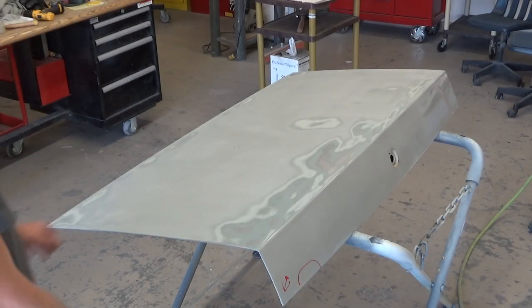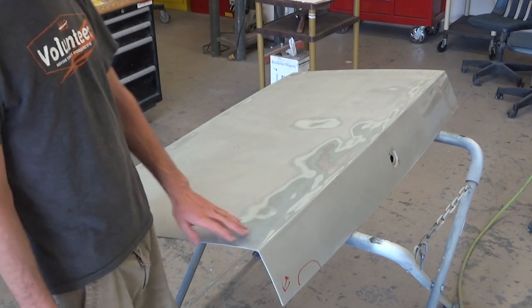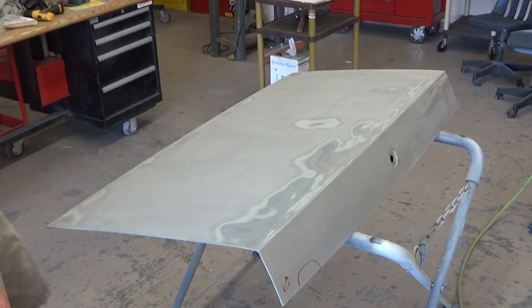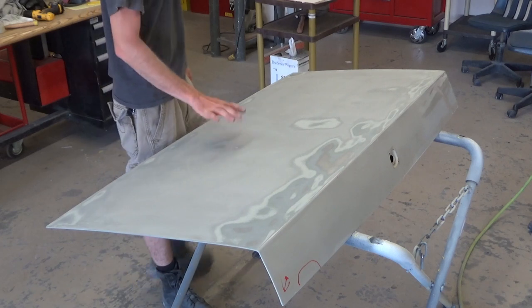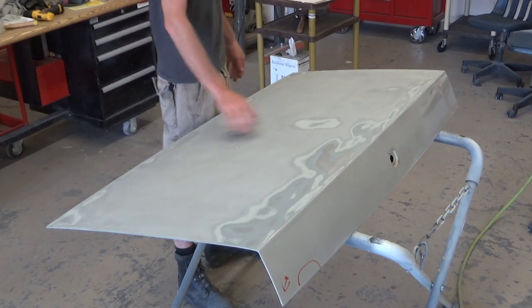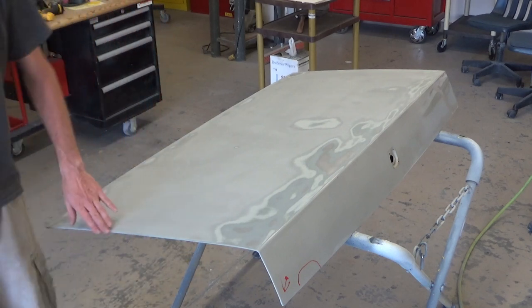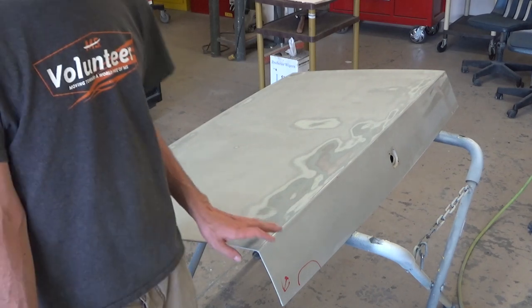So what we have now: virtually all the shiny paint is gone — I've got one spot here. If there was a low, I dug it down to the metal so that I know to put filler in there. If there was a wave, same thing. That one little high looks good. At this point I'm going to put a tight coat of body filler, but I'm going to make absolutely sure that I don't put any of that on glossy paint.